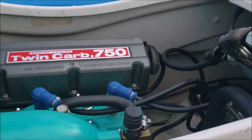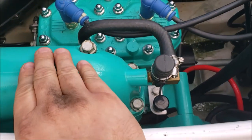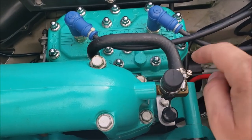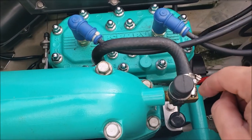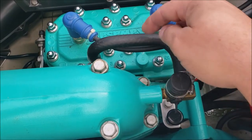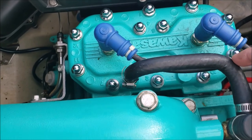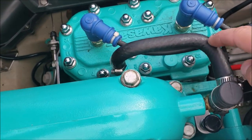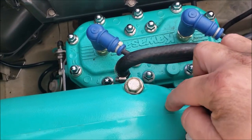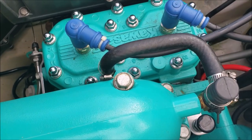Here's the engine and here's the exhaust manifold. The way these two-strokes work is water is pumped in and spit out through the exhaust manifold. It's sucked in through the bottom, but this hose right here — as you can see it connects to the top of the motor — this hose is what moves the water through the engine, and then it's expelled out the exhaust manifold and spits out the exhaust.